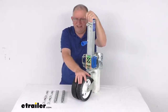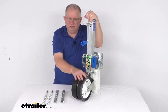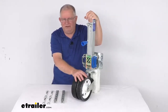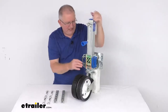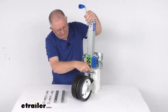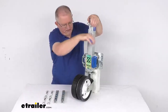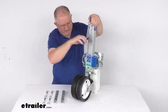Or if you're off-roading and traveling through rough terrain where you might have issues with ground clearance, you can lock the dual wheels upright. The locking feature also keeps the wheels from swinging around while you're driving, which helps ensure the bearings don't wear out prematurely. There are five different holes and a pin that goes into the holes to hold it in position. When you extend the jack far enough, you can see the pin comes out of the hole.